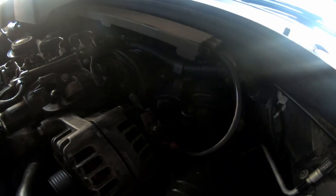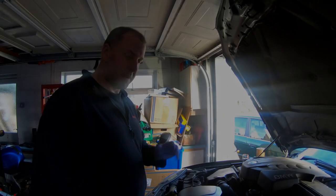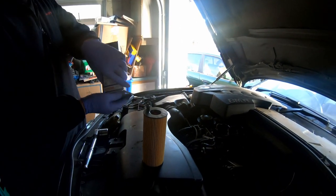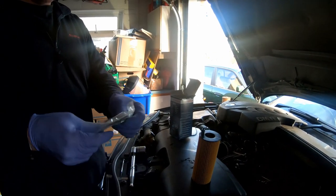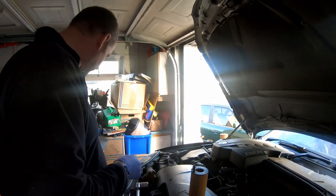While I've sorted that out it's a good time to change my gloves. Right, fresh gloves. New oil filter - there's the seal and the new copper washer. The seal will go on the cap and the copper washer obviously goes on the sump plug, we'll come back to that in a second.